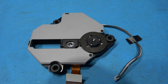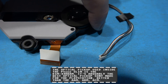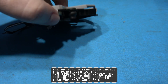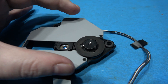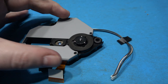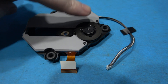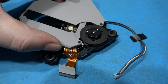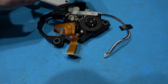To remove the plastic shroud is actually very easy. There's a screw here and a screw here that you need to remove. If you turn it round, you'll see a clip at the back and also a clip on the side. Once you remove those screws, you slide it back and move it this way to bring it out from the clip, then it will just swing out like this. I've gone ahead and removed the two screws, opened the clips, and there we go — we're out. Simple as that.